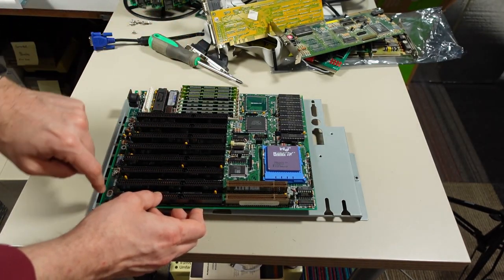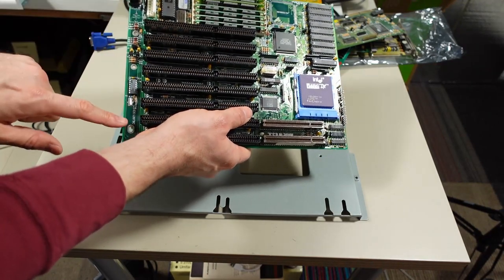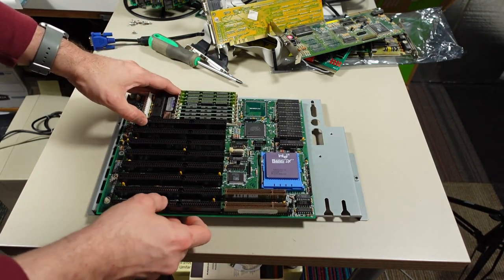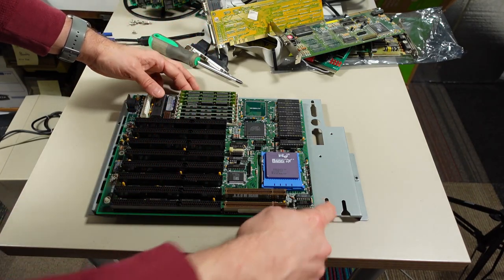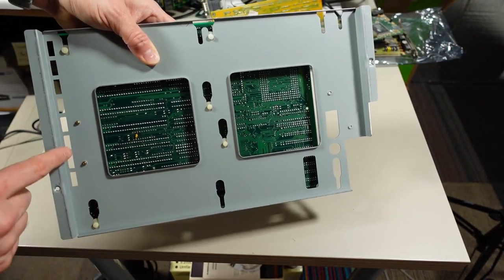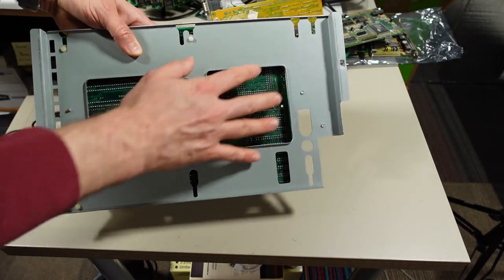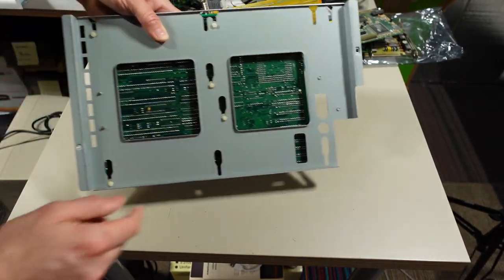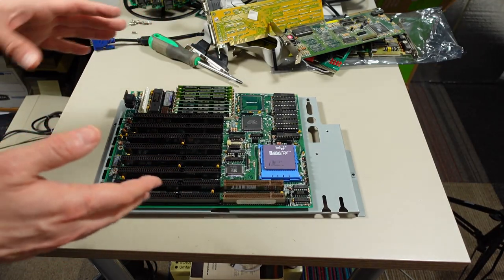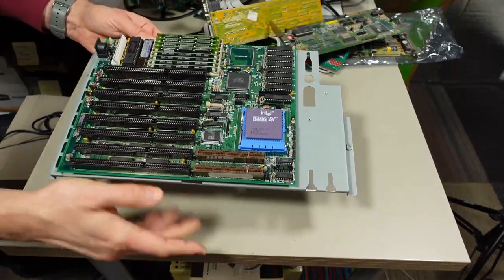The first thing you have to do is look at all the holes on the motherboard and make sure you have the plastic standoffs installed in all the spots that will align with the base plate. You hold it like this and look down — you can look through the hole and see the slot. These were already on here so I know they're in the right spot. Basically, you put the motherboard down into these holes and then slide it in the direction that locks it in. The fact that there are two screws means that this motherboard is now held in there pretty tightly.